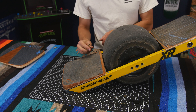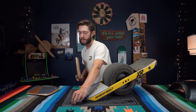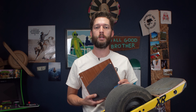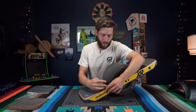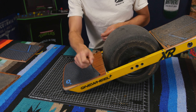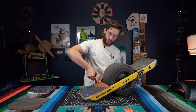Then you flip it over and do the two top screws — that way the foot pad doesn't just drop on you. We're saying goodbye to the Surestance Pro Fusion back foot pad and we're going to install the Surestance back foot pad, which is what comes on a stock OneWheel Plus XR. Take the fresh screws and engage the sequence — the main thing you need to do is not screw these in all the way as soon as you put them in. Just get them in a little bit so the foot pad can figure out where it needs to sit correctly, then once all four screws are in their respective holes, go ahead and tighten them down.